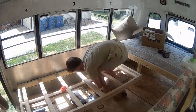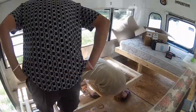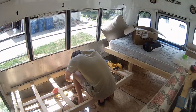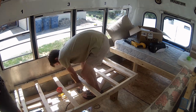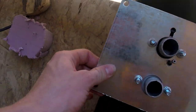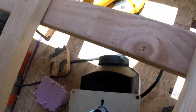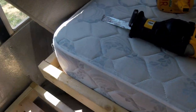Alright, looks good. I got the hole cut right there and got this installed. To cut the hole I used the jigsaw to get the wood and insulation out, and a knife, and then I used the sawzall and drill to cut out the metal bit underneath.